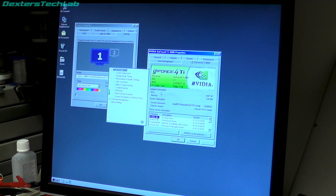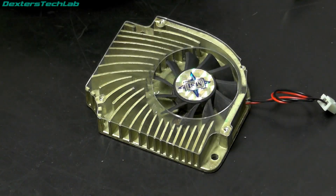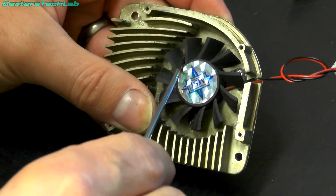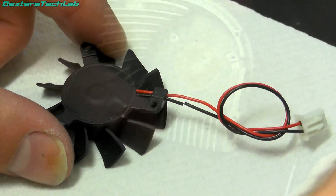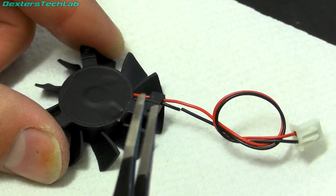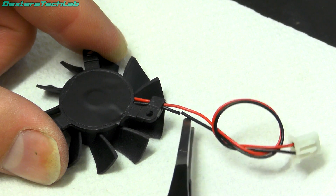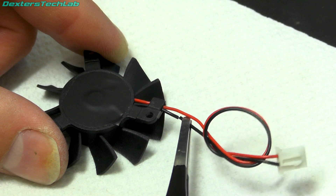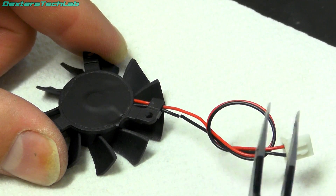What I'll do now is take the card back out, I'm going to take the fan off because I want to give that a clean and a bit of a service and then we'll remount that with the thermal transfer paste and we'll do a quick benchmark. Another thing I noticed when I took this out is the ground wire for the fan is actually slightly broken. The wire is good but the insulation has been cut away - not sure what's done that, maybe it's been caught when it was assembled. I'm going to fix that up and also make a neater job of the fan wire as well.